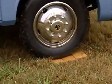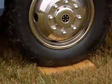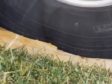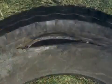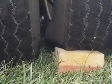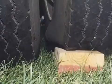Extreme caution must be taken to ensure that the tires are fully supported when using blocks to level motorhomes. While leveling your coach, never block a tire with only part of your tread supported. This can cause damage to the radial cords in the sidewall and stresses the tread. Blocking only one dual will cause that tire to be severely overloaded and will bring it out of service early.